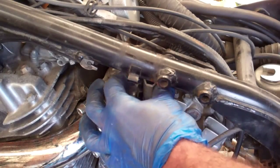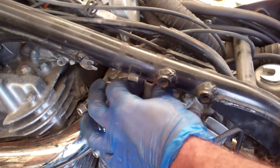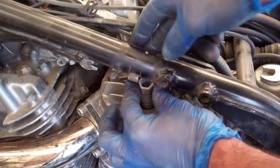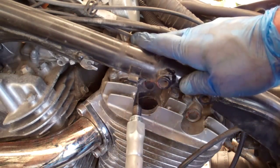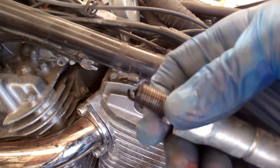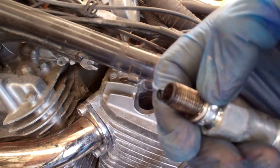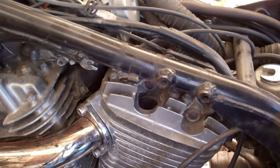I'm just going to keep the camera running here for a moment and we'll have a look at this plug. The bike normally runs really nicely, so that spitting and everything going on — I suspect it's been a while since the plugs were changed. Yeah, it's pretty corroded up there, a lot of carbon. I had this out for a couple of really good runs on the highway and blew out any carbon that should have been in it. Anyway, we'll change those plugs.